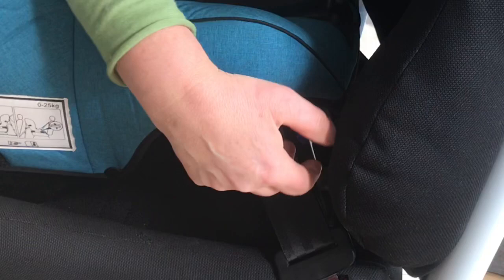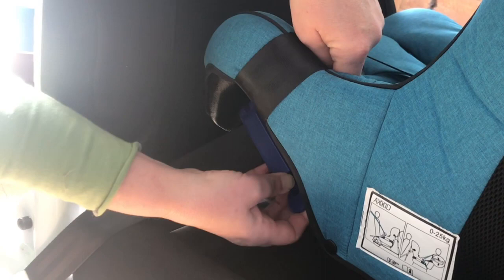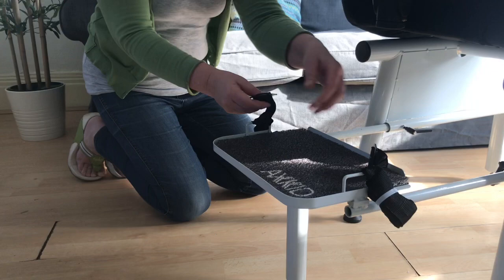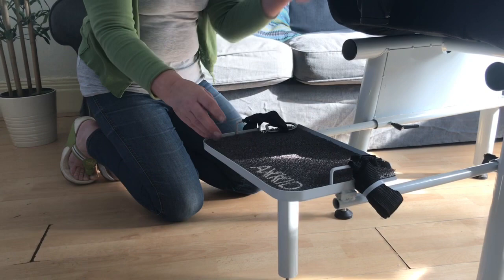Push down on the seat while you pull the top layer of seat belt really tight to remove all the slack from the lap belt, pull it through, and lock this clip into place. On this side you only lock the lap belt into the clip — the diagonal belt does not go down in the clip, it stays above it — so you just close this clip and lock that one down as well. Normally before you install the seat you would have installed your tether straps in the car, attaching to the front seat's runner rails.